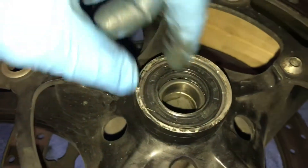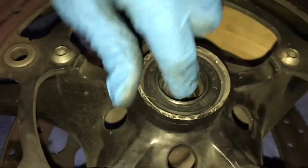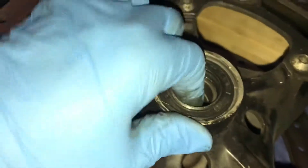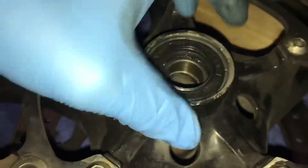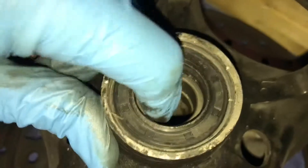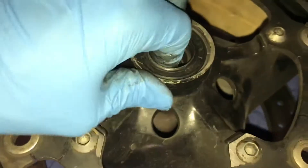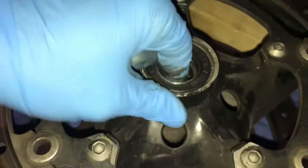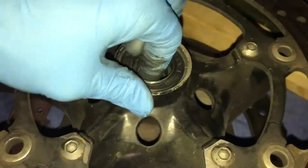The axle would be rotating and it should be rotating with that bearing, but that bearing was locking up and then suddenly giving way. That's what that popping noise was — the bearing giving way every once in a while, and that's where the wheel shuttering comes in. If I had left this, it would have caused serious catastrophic damage and it probably would have ended up killing me. Especially if you're doing highway driving and this bearing just fails — I mean, you're probably going to die.